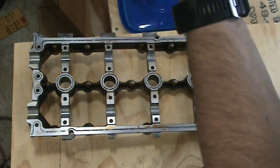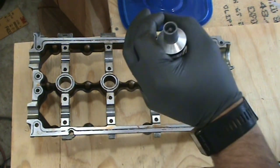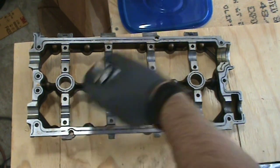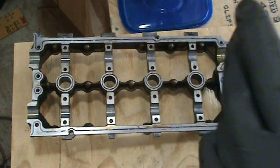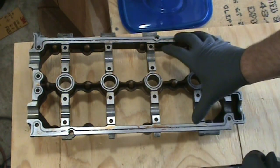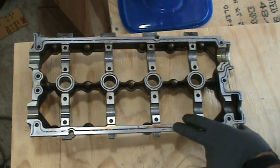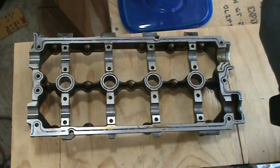And then as far as putting the gasket on here, you want to definitely get it all in this channel. And you want a fairly small bead that isn't going to squish out really past the edges. And then after this is put on, we'll take it out to the car, we'll set it on there, and we'll just lightly tighten down the screws to compress this material a little bit while it's still wet. And then we'll let it set for 24 hours. And really a little bit before that probably, but somewhere in that time frame after it's set up.